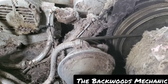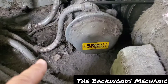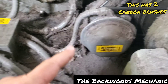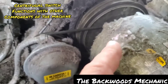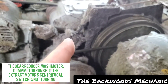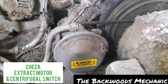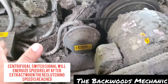That brake system operates during its normal wash cycle, and there's a secondary brake that lets you stop it when you're pushing those buttons. All of this functions together simultaneously. On top of this washer there's what's called a centrifugal switch. Whenever it operates in the wash cycle, that switch on the inside has brushes — some have two little discs — and it all operates together, sending a signal to this motor. When running, it should be spinning. First thing I noticed when I opened the door and tested it is that the gear reducer is running, but the back where the belts connect to the tub is not running. Those components should run in sync together; if they don't, it will cut out your motor and make your brakes not work — that's a dead giveaway.